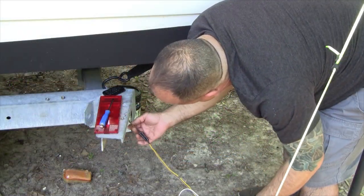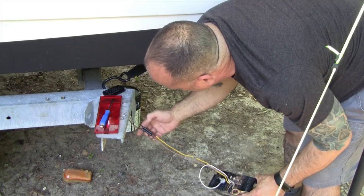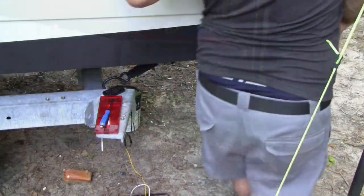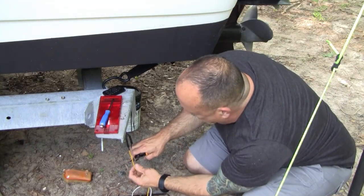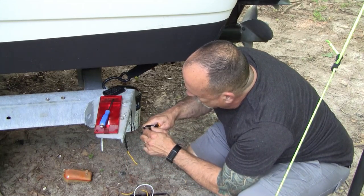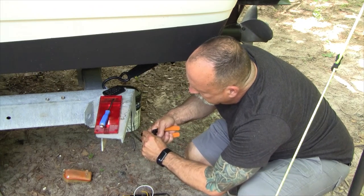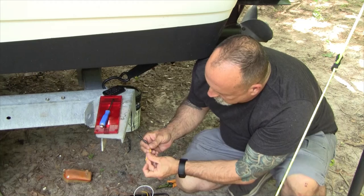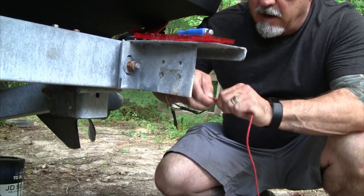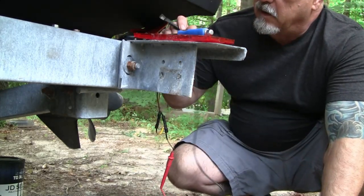You can see the trailer wiring coming out of there. They used shrink connectors and liquid tape, which isn't bad. I'm going to use crimp connectors with shrink tubing on them, but I'm cutting the old splices off here. I don't want to short these to the frame because that's ground. There's a lot of corrosion on those wires as well, so I'm going to check the brown wire first — it should be steadily on — grounding against the trailer itself.